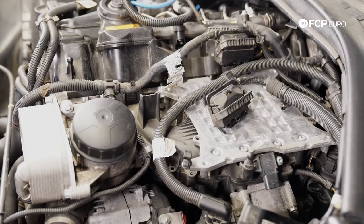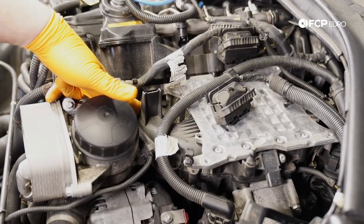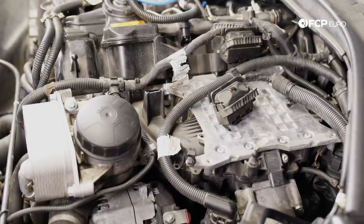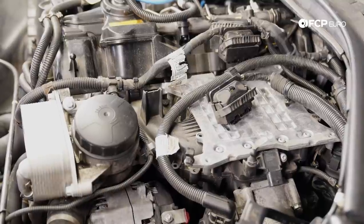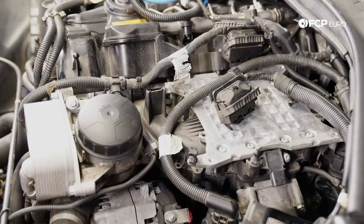What I should be able to do at this point is pull the intake manifold back far enough to get past the studs. This will open up room to this rearward bolt. It'll also allow me to replace the intake manifold gaskets, and I won't have to worry about removing the entire thing from the engine bay. We're like 75% of the way there, but to save time, why bother with the extra 25% if you don't need to do it?